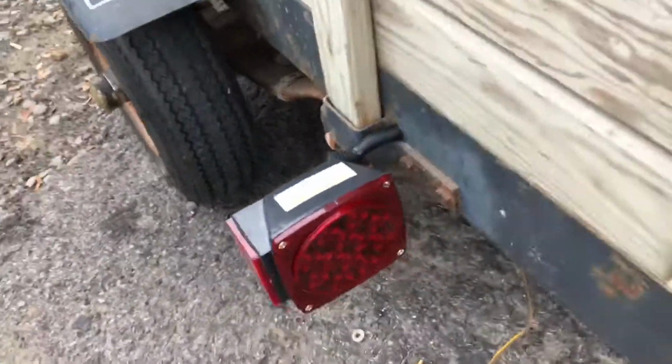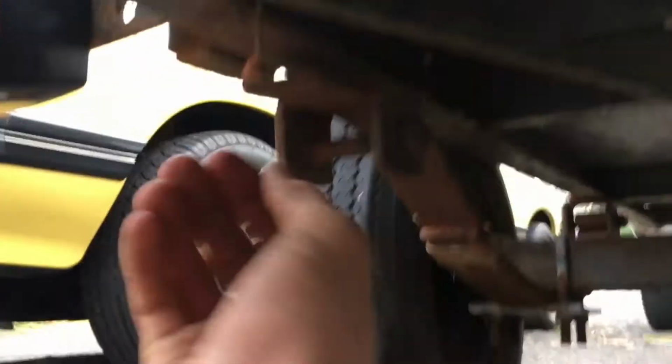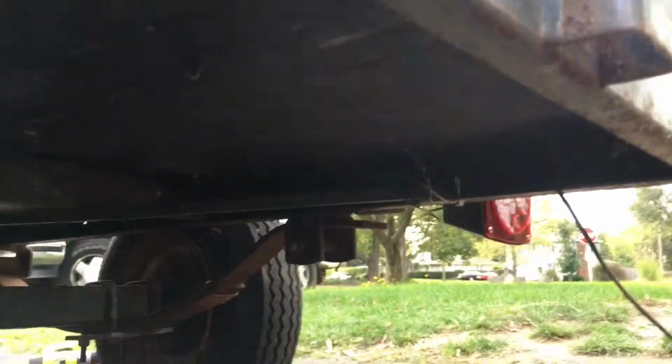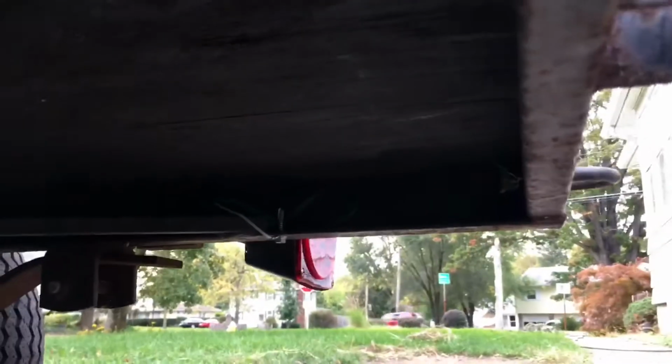And now it's off to the back end. All I gotta do is wire in the blinker tail lights, which I don't think I'm gonna film. It's pretty self-explanatory. You know, brown to brown, yellow to yellow, solder them together. Same thing over there, just green to green, brown to brown. Alright, I'm all done back here. Got everything soldered up there. Heat shrink anything over there. It's all done.